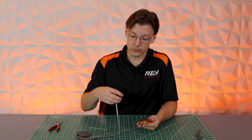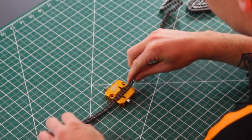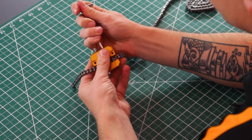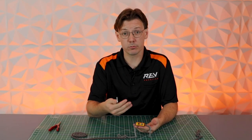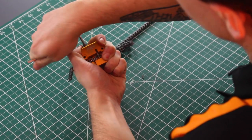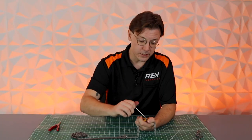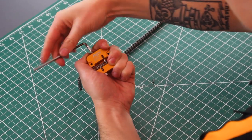Make sure you have one of the inside links ready to go. Take your chain and set it into your chain break tool. Take your compression screw and hold the chain in place, then drive the pin screw in. Unlike with a master link, you do not press the pin all the way through — you want it held in by the bottom plate of the chain. Do this carefully as it requires some feel. Press it through carefully and then back drive the pin screw out.